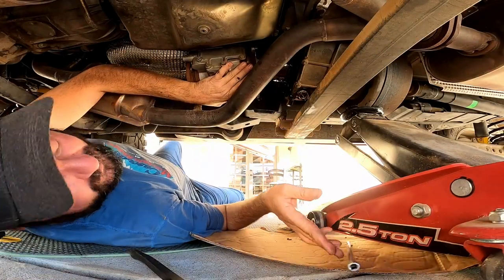In the last video I removed the transfer case front output housing from my 2004 Discovery to put it in the 2003, and I got really frustrated trying to pull that thing off. I realized I made some mistakes — the biggest one was when pulling that nose cone off. The high-low shift fork is a really tight tolerance and you have to slide the housing off of that rod. I was hung up on that rod and didn't realize it because I was underneath the vehicle, so it really helps to have a second set of eyes.